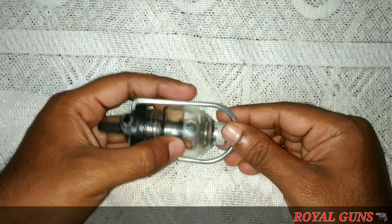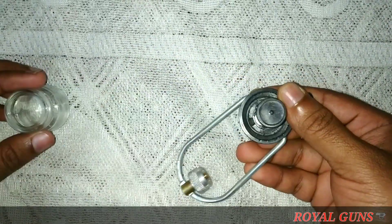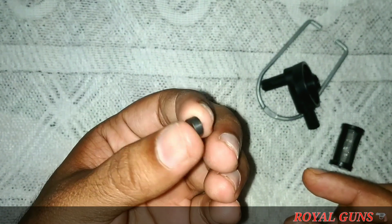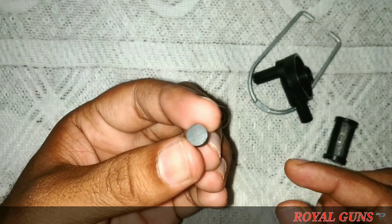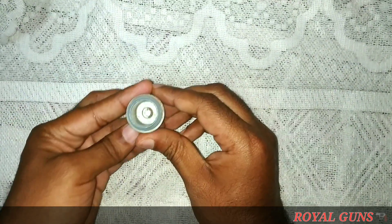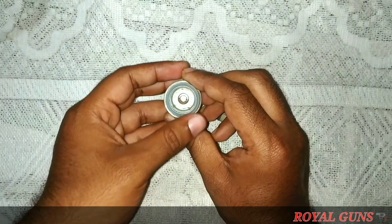Let's disassemble this and see what we have got inside. First of all, we have to open it here and remove the nut. Here we have a filter which you can remove from outside. If you look inside, there is a magnet. The magnet works to catch the metal dust that comes from within the tank. That dust would otherwise fall into and affect the carburetor. This is the Royal Enfield standard fuel filter and you can see rust has formed on it — this rust goes into the carburetor. With this new filter, the rust will not go into the carburetor; it will stick to the magnet.